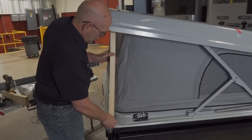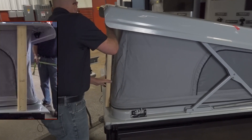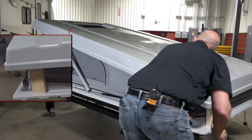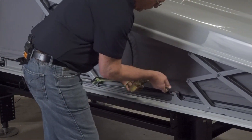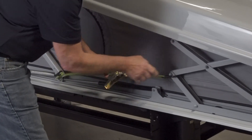The first step is to open the pop-top and install the 35.5-inch wooden support in the front between the top and base piece. Then install the 12.5-inch wooden support in the back between the top and base piece. Install the ratchet strap on the pop-top metal support frame and tighten to remove tension from the gas strut and spring.